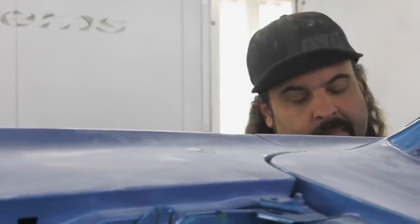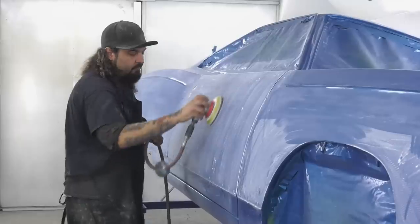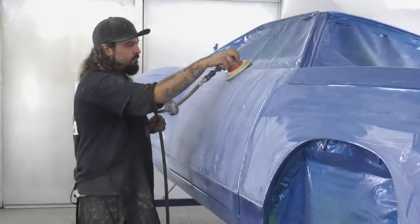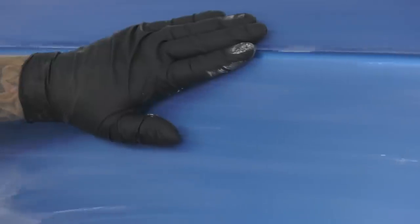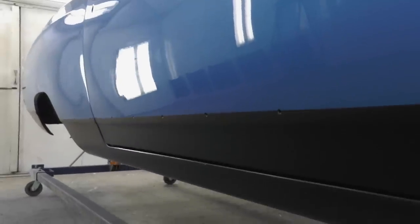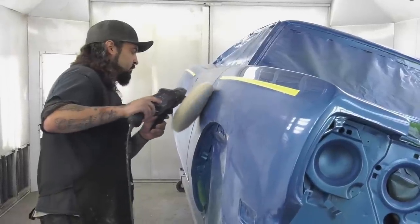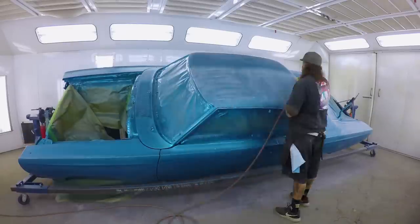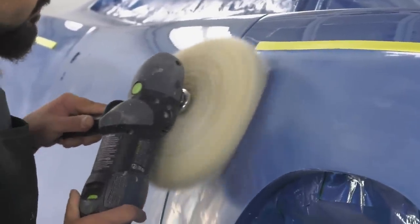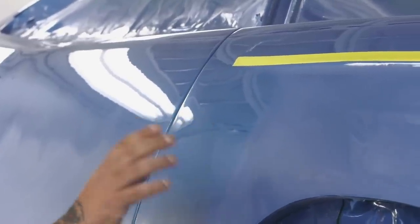Having somebody to assist me in the cut-and-buff process now is a lifesaver. We'll start with 800, 1200, 2000, 3000, and then start to buff. When you have to do the blackouts on the hood and rockers — because they go a flat color — you really ought to make sure those areas are buffed out to perfection first. Because once you do the blackout, it's extremely hard to go back and do any touch-up buffing. If you hit that flat black with the buffer, it'll make it shiny, and then you're having to redo all the flat black. It just takes a little more patience and attention to detail.